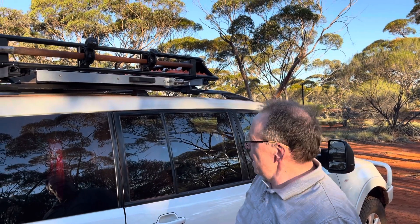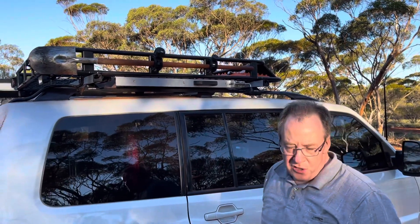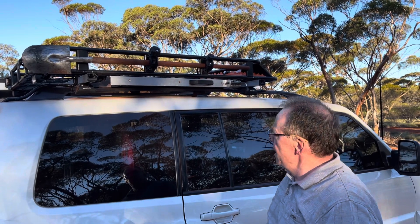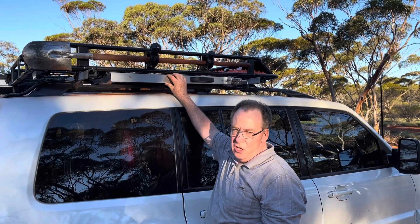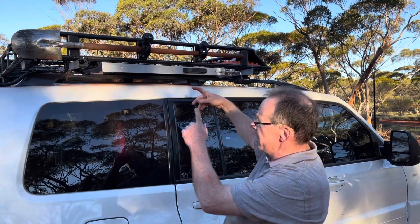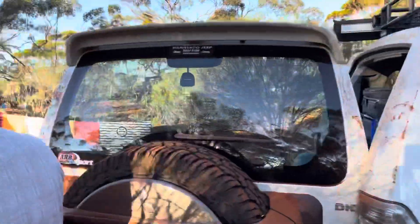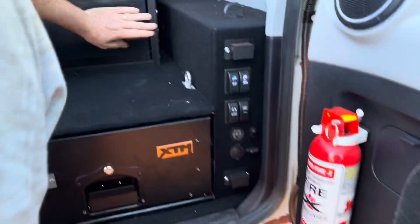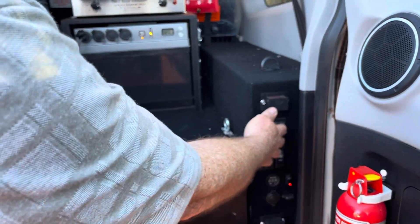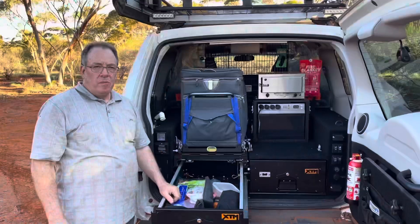I constructed this myself — I saw a design on the web from a company called Dunham Watson in Queensland and bought the sliders off them, very high quality. If you want to make your own, or you can buy a complete unit for around $700 with a 100-watt panel and fit it yourself. I made mine because my panel was a bit bigger than the one they supply. The switches here all operate off this auxiliary battery, so they're not draining your vehicle battery. The work lights come on off the main vehicle battery, as does the water pump.